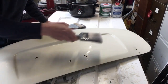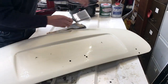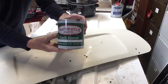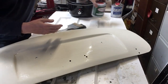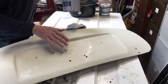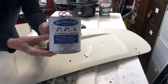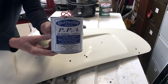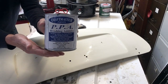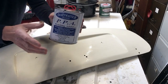This other brush is by Harris — a brilliant brush. I'm going to use this today to paint this boot lid. This is the paint I'm using: Old English White. You put that on neat to start with for the first two coats, and then you thin it with up to 10% — no more than 10%. So you pour it out into a little tin, say 300 mils, and add about 28 to 30 mils maximum of the thinner and mix it in well.